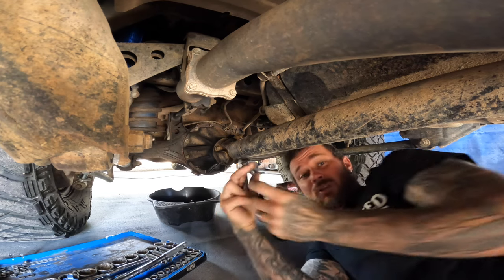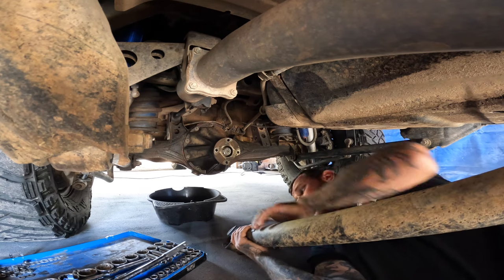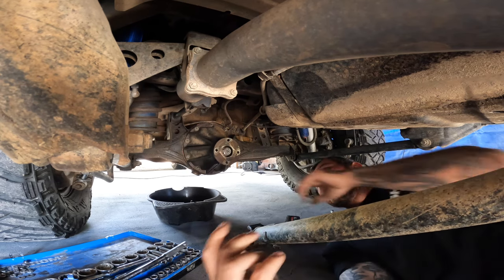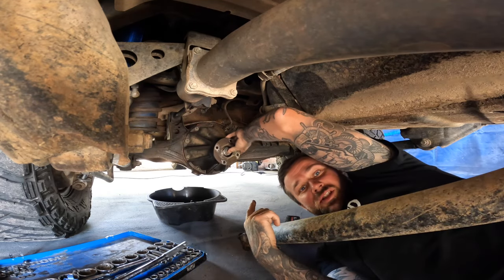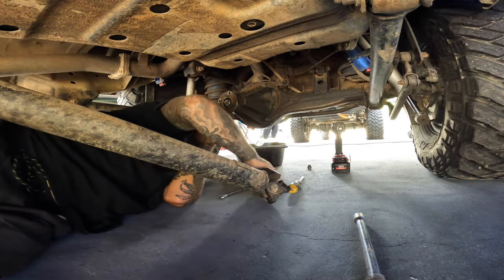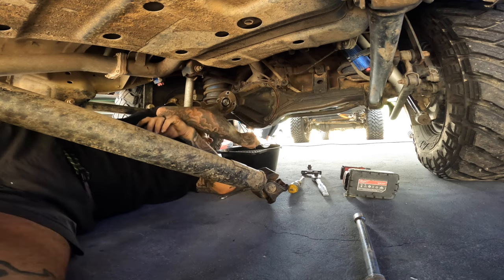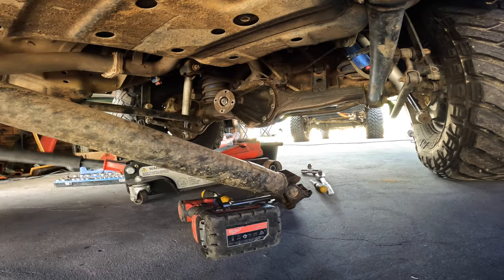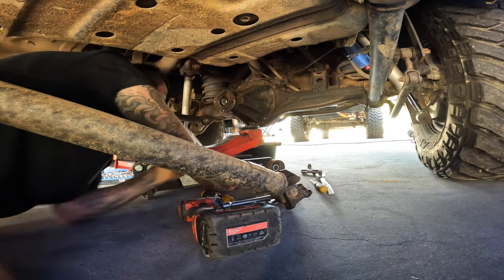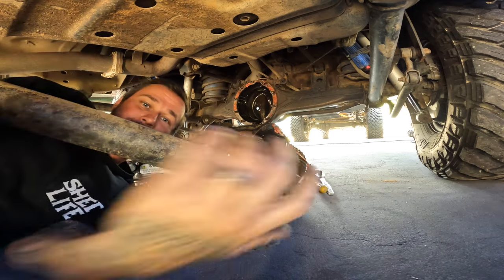The best thing about rebuilding all of this is I should be able to get all the seals stacked together. Just nice and gently get the tail shaft down — careful not to drop it, you don't want to bend it. You could take it off and move it out of the way completely. I'm also going to drain the fill plug and the drain plug. Try not to do what I always do and drop the diff plug in the diff oil.